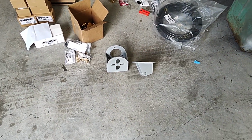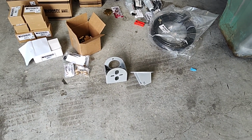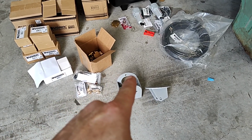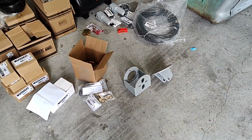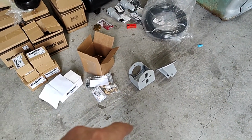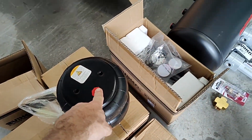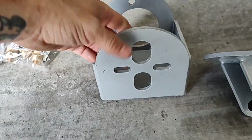I don't have the aluminum lower control arm. I have the steel one, and it worked. Everything lined up. It was really easy on that side. So the only thing I had to do, like I said, was drill out a couple holes there. I held it up in place, and I'm going to show you this on video too, but I'm going to give you a little explanation real quick. Just held it up in place, marked the holes through the top where they needed to be, got it out, drilled them, and then I got the fittings for this that came with the package. I'll put that on, and then you go ahead and connect it all together with your bolts.